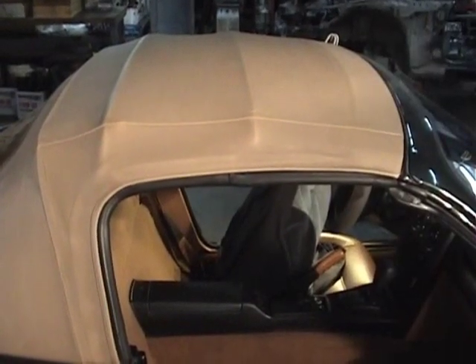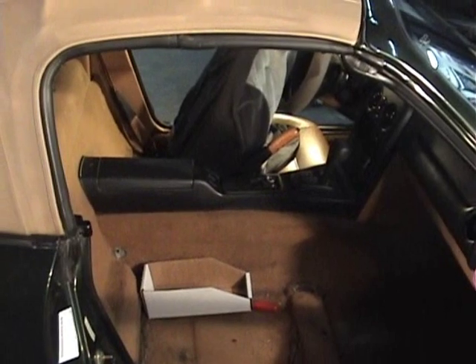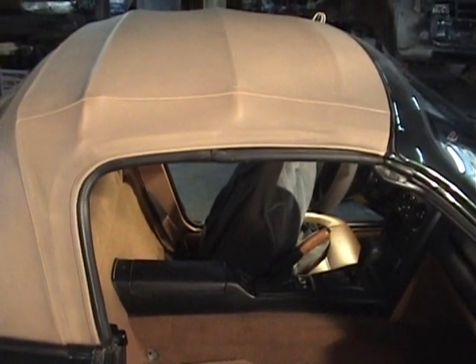The top is back up. Now we're going to crawl into the car — we've made room — and start taking the apron out. Inside, there are thirteen trim buttons to remove. Once those are removed, we'll remove the three rain rail fasteners: a left, a right, and a center, all unique. There are thirteen bolts holding those in place. Using the fork tool under the plastic snap retainer, we pull it loose and go all the way across.